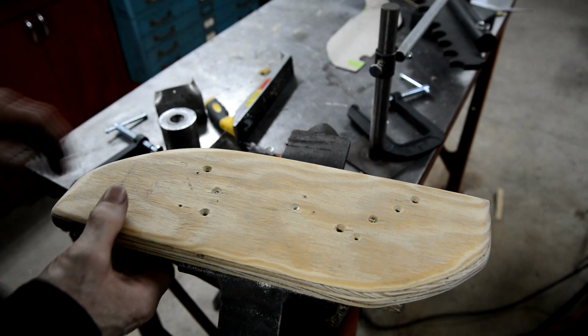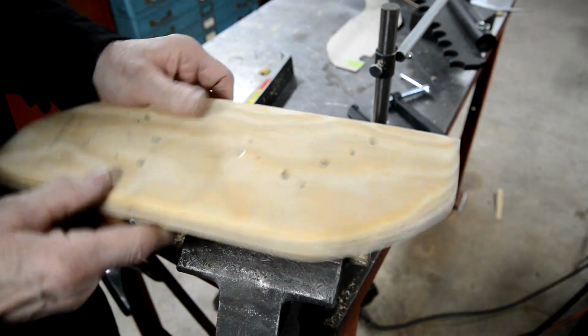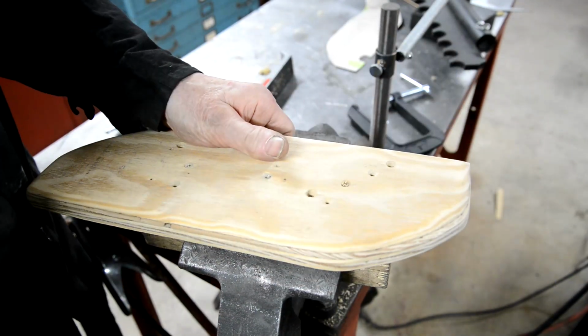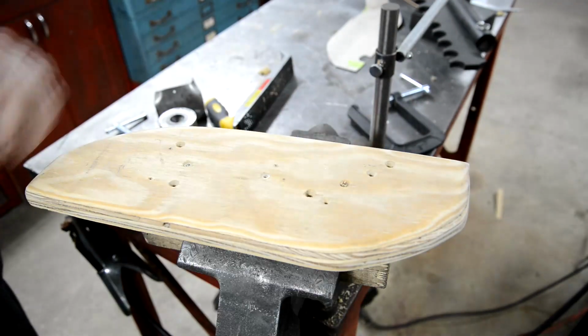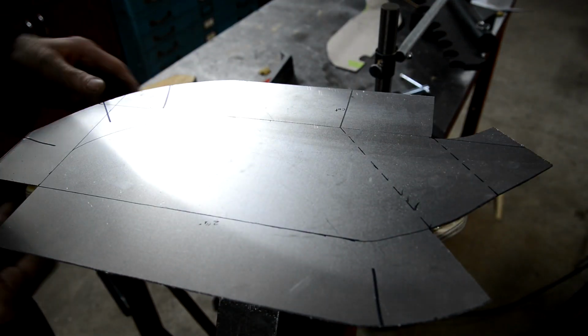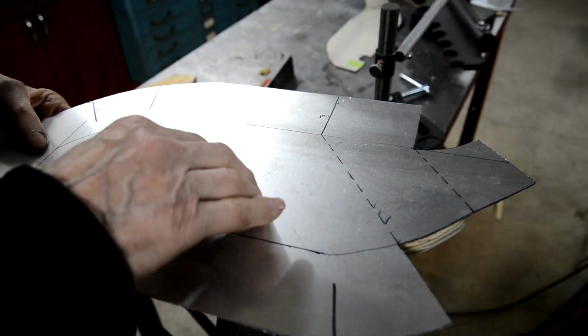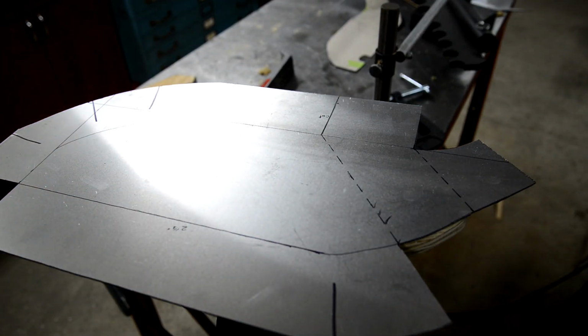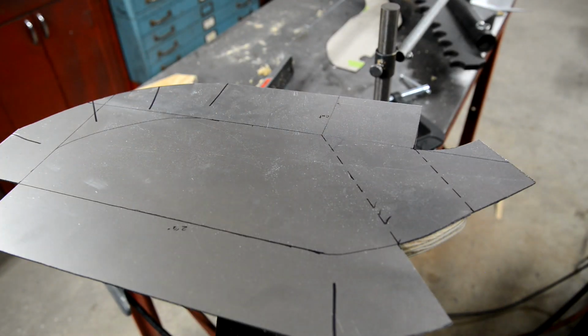All right, let's do some work. Now here's the form I've made. I decided I only needed one thickness because all I've got to do is turn this over. So it's screwed into that, which will go into there. Right, then all the edges are rounded over, so that's what we're going to form over. So that will go on there. And there's a couple of places where I can get this sorted out so that I know it's in the right spot. Because don't forget, when I anneal this, I've got light shining on it again. How's that? That's better. When I anneal this, all of these marks will come off.